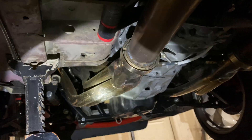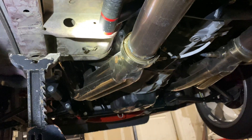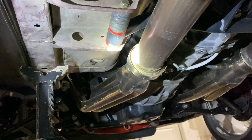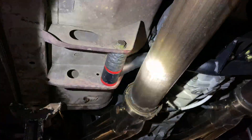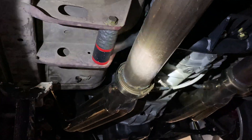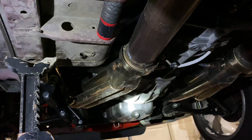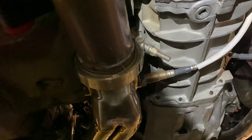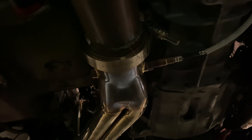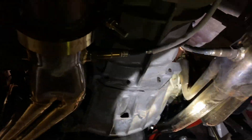We're gonna find out today. I haven't had to replace the clutch on one of these yet. I did it on my other car which was a T56, and I was able to do it by just pulling the tranny out — not the motor. So we'll see what it actually takes. You can get a full drivetrain, driveshaft brand new for $300, cross member about $50, transmission I paid $250 for it, clutch another $350 — so on the high side, $1,200 for a full transmission, driveshaft, shifter, cross member, and clutch. Compared to a T56 that's going to run you about $2,500 for a 2003-2004 Cobra one, or $3,500 just for the T56 Magnum, and that's not including custom cross member and driveline.